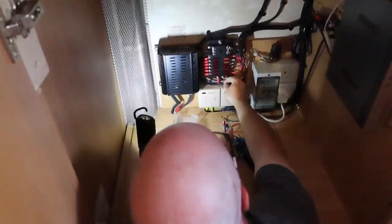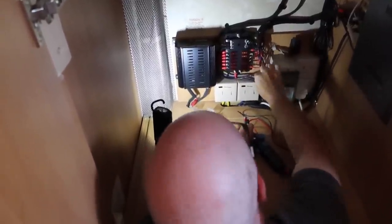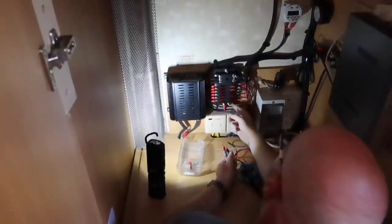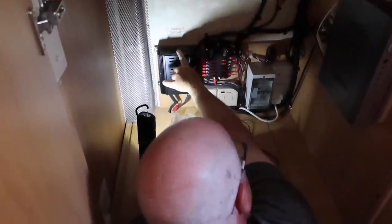And you've got the fuses in the floor. That's the only cable connecting it back to the original wiring. That tiny one there. But yeah, they've not mounted the earth point there, and the positive that is mounted there goes to that, which I'm guessing is your relay for your charge. Well, that's your battery charge, so when you plug in on mains, that's charging that.